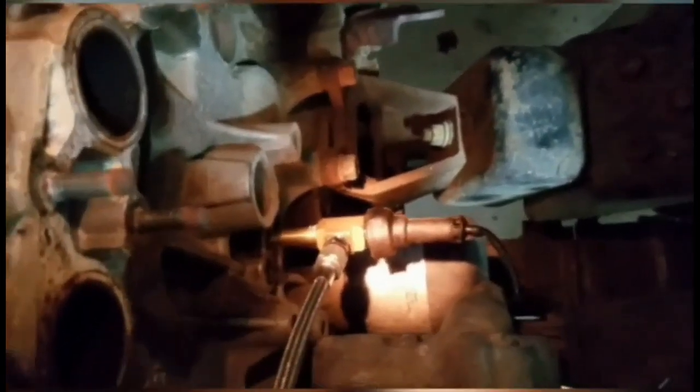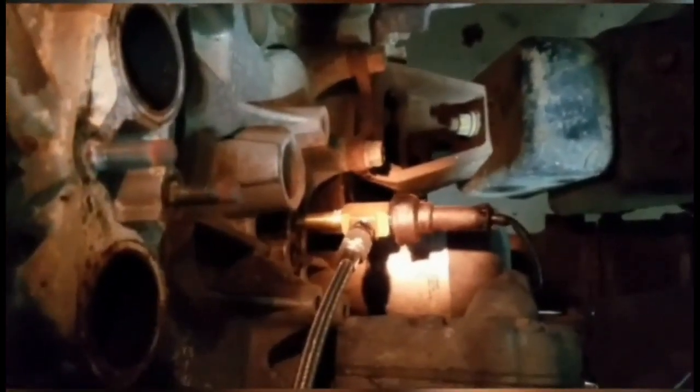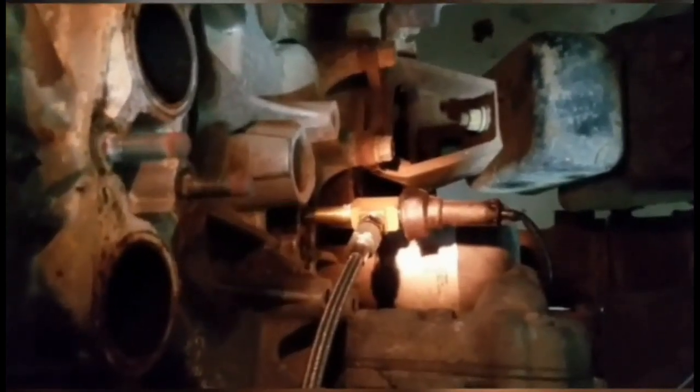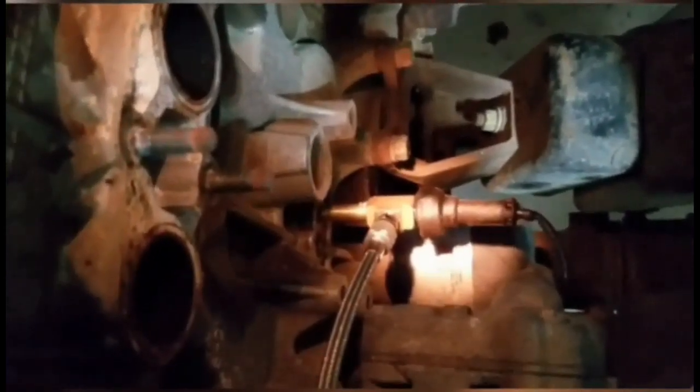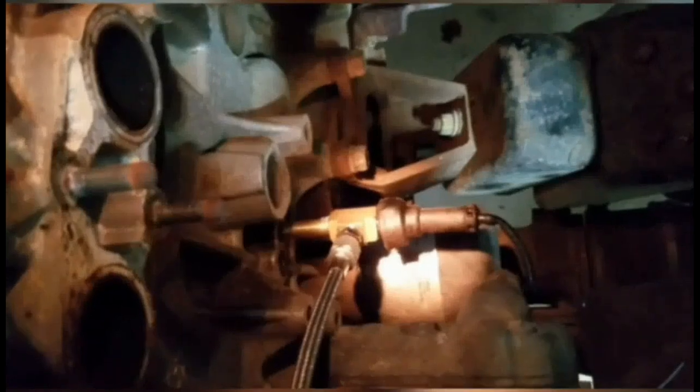In the next phase I'm going to do the oil return to the oil pan. I'll have to reset up and show you that. After I get this done I'm going to do an oil change because I've got to drill into the oil pan. You can do it one of two ways — drill into the oil pan and put a backer nut on it, or just drill a hole. Hopefully you drill the right size so it seals up tight. It's non-pressure, so it just needs a good seal to keep oil from splashing out. I'm going to drill the hole in the side of the oil pan.